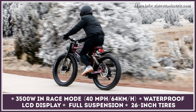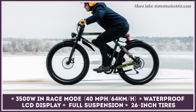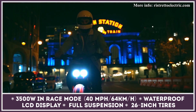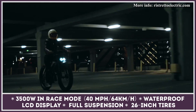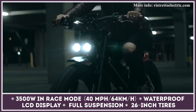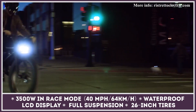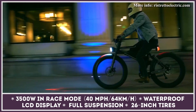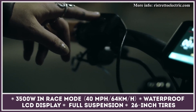The full potential of this model is best experienced in the off-road environment. The unique suspension system on the 303 FS includes preload, compression, and rebound adjustments, letting you fine-tune your preferences for a smooth ride even over bumpy hills. The fat motorbike tires ensure the best possible grip and let you reach speeds close to 40 miles per hour in race mode. The bike's 52-volt 17.5 amp-hour battery is said to last up to 55 miles on a charge, though this figure depends on weather, rider weight, and riding preferences.